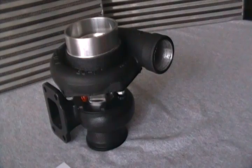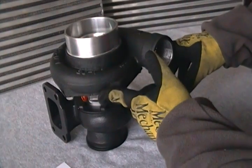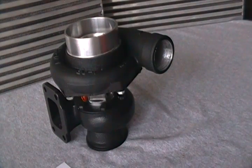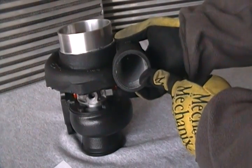This is the same flexibility you'd have with the Garrett GTX series and GT series 35R turbocharger. Standard for this particular turbo is a T3 inlet with a 0.63 AR outlet, which is good to about 650 horsepower or so. Unlike the journal bearing version, we don't get to change turbine wheels — with the journal bearing version you could use either a 71 millimeter or a 74 millimeter turbine wheel. Lastly, this uses a 0.70 AR T04S compressor cover with a 2.5 inch outlet.